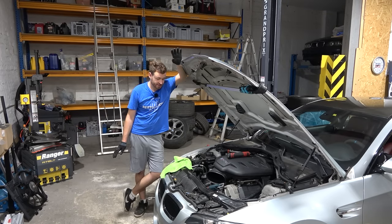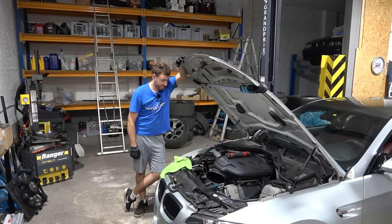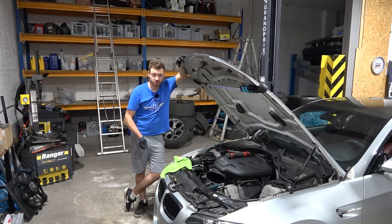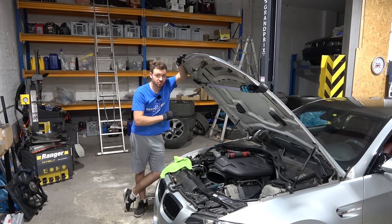Okay, RTV on the front crank seal. Can't really explain that. But given how much play we have in the crankshaft, we can move it up and down. That means that it's either broken, at least the front part of it, so we can move it, or the main bearings are completely wiped out. They don't exist, and you can just jiggle the crankshaft as much as you want. It's possible that it spun main bearings. These engines have a problem with that. And when that happens, you can throw away the whole block.